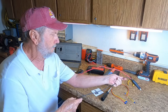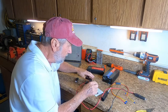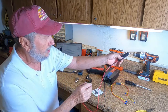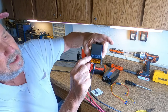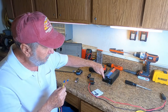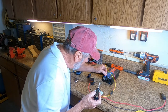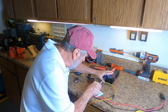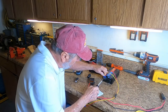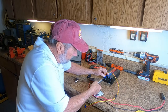Then my negative is going to be the same way — I'm going to have to bend this up just a little bit and screw it down. This will do for the demonstration. Now I have positive and negative, red and black. I'm going to connect the output of this remote switch to the inverter. I'm going to use the positive here — positive is red. And I'll use the yellow as my negative, and just stick that down in there.